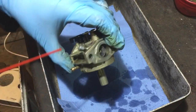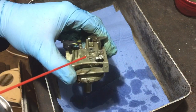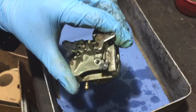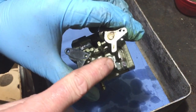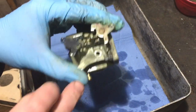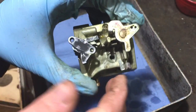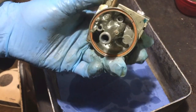I don't generally take out the fuel adjuster screw because they're generally set — you can see that one doesn't even let me unscrew it any further because it's got a tab on it. I'm going to leave well alone with that. I never find a need to remove it unless I put it back on and it doesn't run properly. On this particular one you'd have to break that little aluminium tab off to unscrew it — that's just how Honda does it for that fine setting.